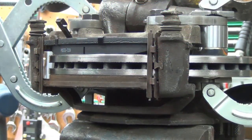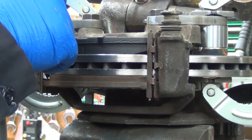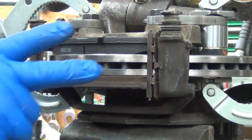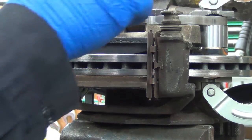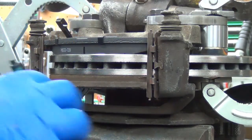I've got the 0.900 spacers in there, and right there is the point I'm looking at - it is centered again over the rotor, so that's good. I still have to play with the positioning a little bit. These pads here, they stand proud a little bit. I ground off the thing up here that was hitting it - these pads are okay.